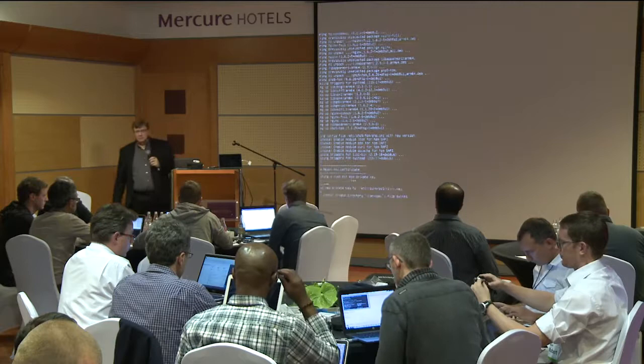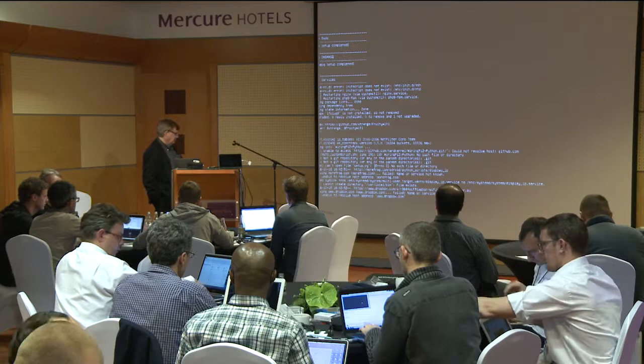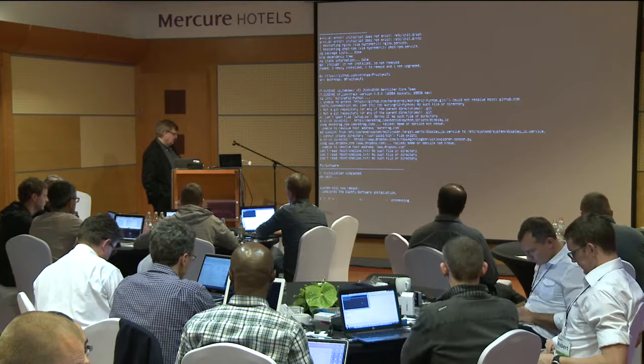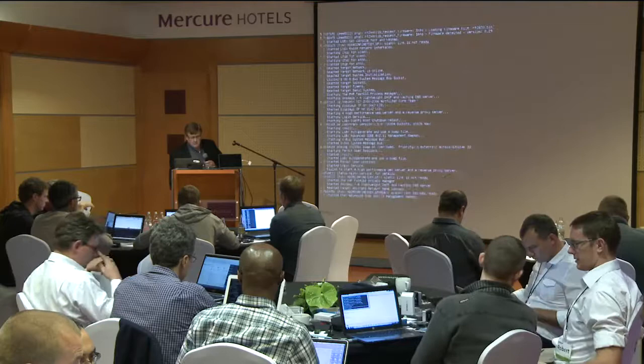Now that it's working, destroy it. Kill it? Yeah. Wait, you're already associated to it? No, not yet. But you saw your name. I saw the SSID. So before you kill it, with your phone or your computer, join your name SSID with the password you put on it, and you should be able to go to 192.168.42.1 and log in with admin. Then you'll see the screen. Before you kill it, and then come back. Okay.